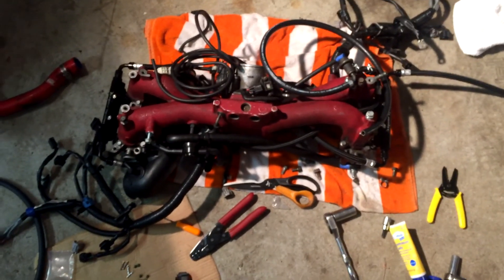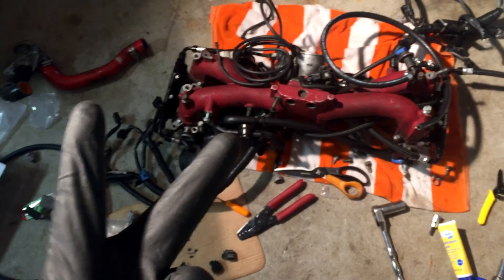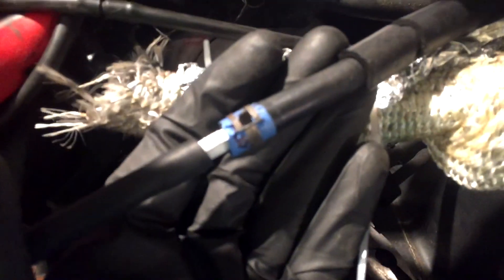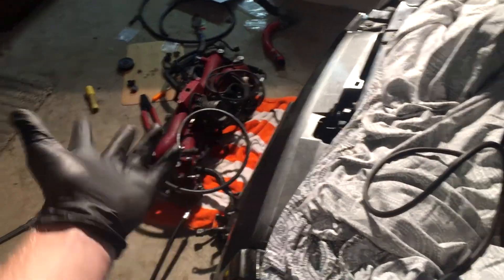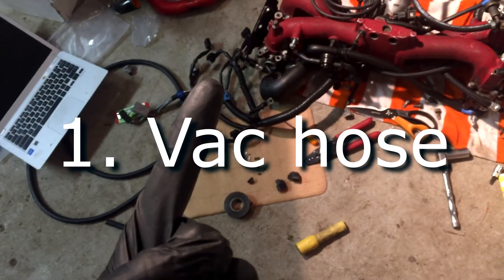You definitely need more vacuum hose, and more of what I'd call purge hose. This bottom line of the triple fuel line tree attaches to a metal piece, goes under the manifold and into the purge valve — I think it's fuel vapor related. But we no longer have the metal line, so you're going to need more lines. I bought all this extra line so I had plenty. I'm routing it under the manifold into that blue connector, bypassing the metal and maintaining the stock purge system.